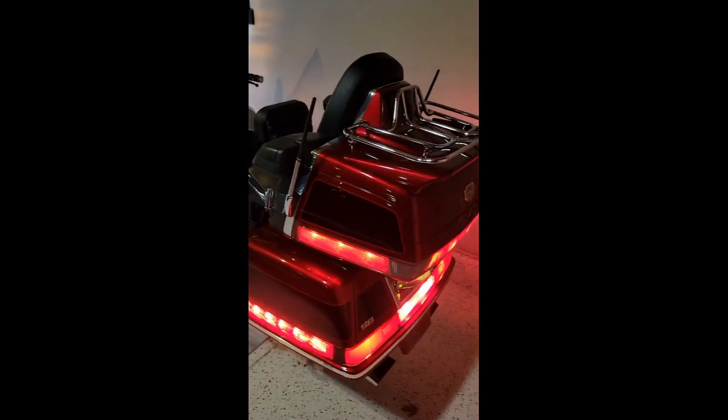So I have LED flashers, two flashers underneath there. You'll see them. Once, like I said, that panel is off, you can literally orient your hands and get right underneath here and you can feel them. They have two rubber boots on there. They're mounted on a post. You can wiggle them and slide them right off. And you don't have to put them back on the post on the boot if you don't want to. You can actually just use a tie wrap to secure them underneath there. Everything will be fine. So that's it, folks.